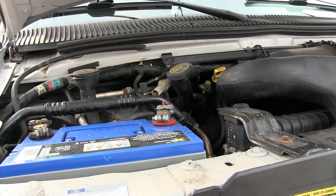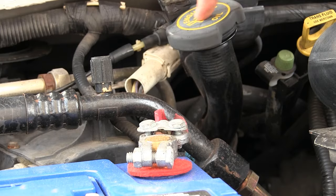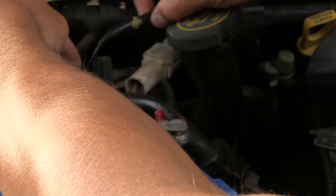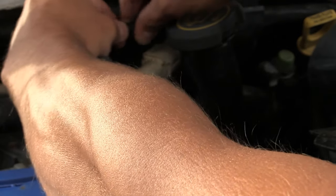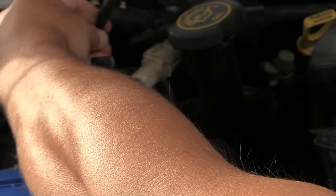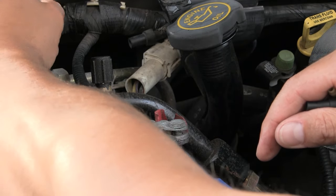After you've purchased all the items, come up and open the hood and find the vacuum line — it's located next to the oil fill cap. You can see there's a little connection here. This is the line that goes into the heater box, and this line — you can see it's a little bit red — goes right to the engine, so this is where the vacuum's coming from. We're going to disconnect this portion here, feed it through the doghouse to use on the inside, and abandon this line right here. We'll use part of it once we go back inside the van, but we're going to abandon this portion.